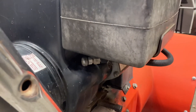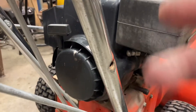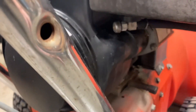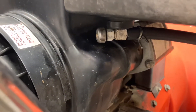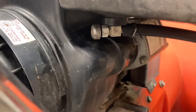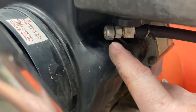I had a fuel leak before where this hose had just gotten rotten and broke, so I had to pull the cover off, pull the cover off the other side for the carburetor, run that hose back through there, and replace that. But the new leak I've got right now is right on the end of this fuel shutoff. It's a very simple shutoff — you turn it in to shut it off, you turn it out to turn the fuel on. All there is in there is just a brass rod with a cone on either end that closes or opens the port. But over time it just wore out, so now it leaks right here.